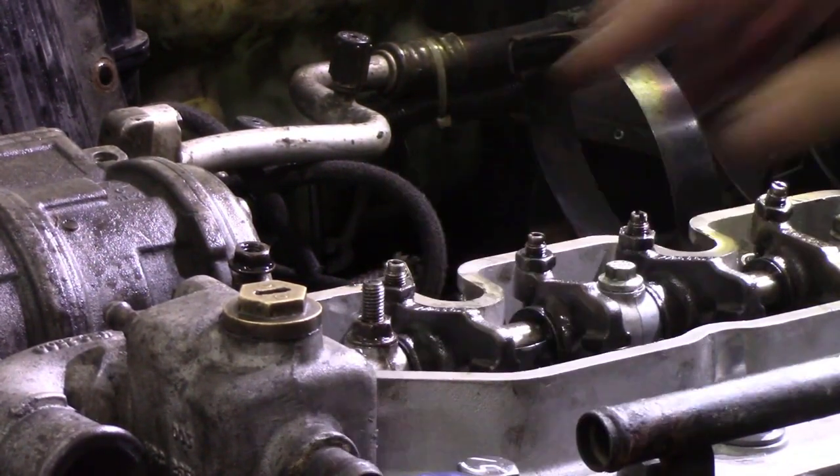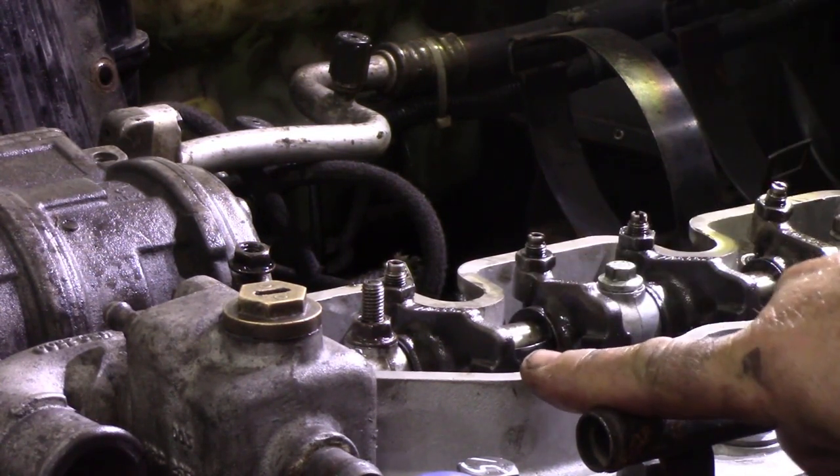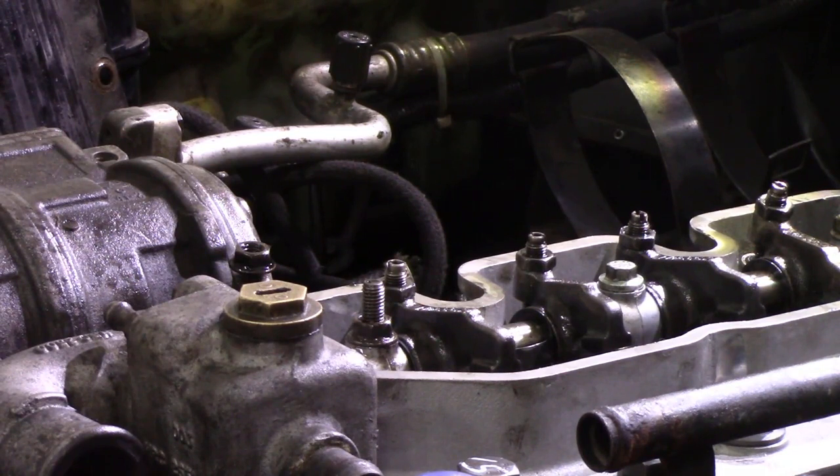How simple is that? It's also a good way of finding top dead center on your truck if you can't find your timing marks — when these rock, it's on top dead center. It always has been, always will be, unless it's some unusual car. So what we're going to do now is simply set the valves — you've seen videos of setting valves before, but turning the wheel is a really good technique.